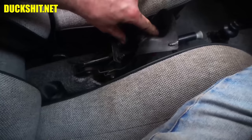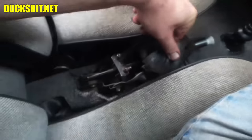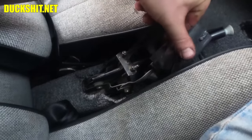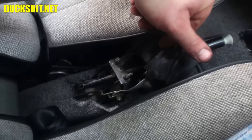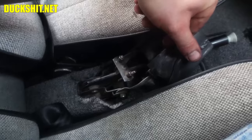See, it's actually coming off of its little pin, which is broken off of this thing, too. You see the little hole in the middle there? Right there. It only has a pin that comes up through there, and they break off on all these cars. You can function without it. Yeah, there is a purpose for it to be there, so the balance beam doesn't fall off in the event that the cable's loosened, but it'll be real easy. We're just going to loosen the nuts and then run them back in and then check the thing.